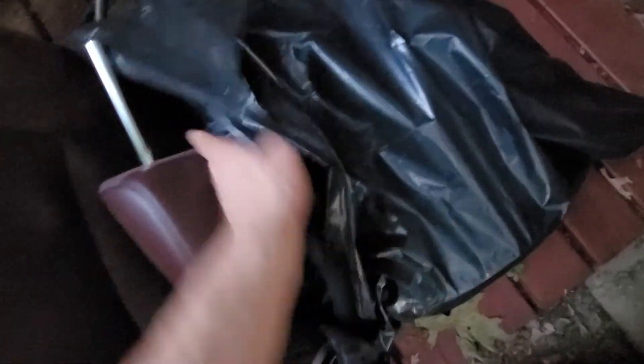Damn, boy! That's a pretty nice result from the upholstery cleaner. Alrighty, been a couple of hours and I've been cleaning all the upholstery. Let's see what we got here - hold my breath to open the bag. All right, I aired it out. Let's do a sniff test. This is where the cologne was very strong - now I can barely detect it. Perhaps it worked. Bottom line: do it as long as you need to until you're fairly confident the smell is gone. Let it air out for at least two minutes each time, because ozone is heavy and tends to linger.